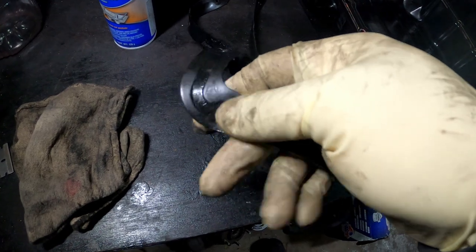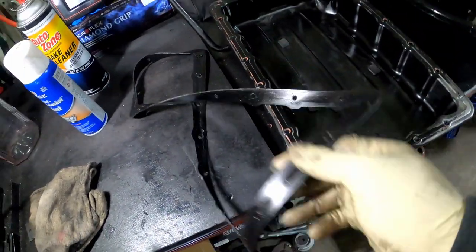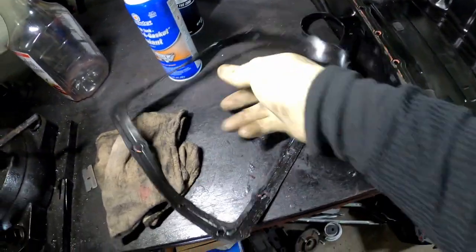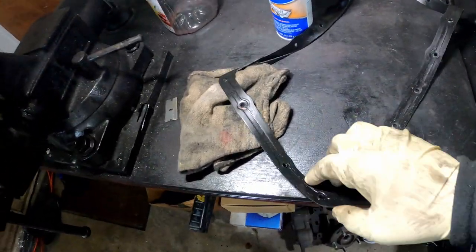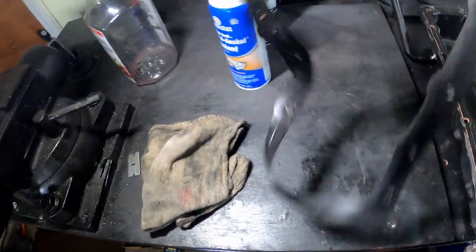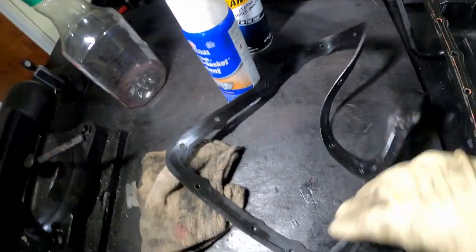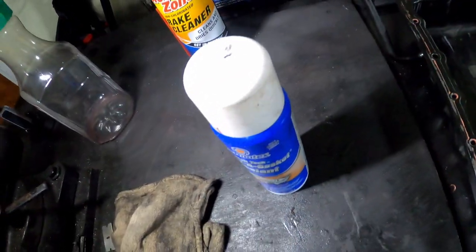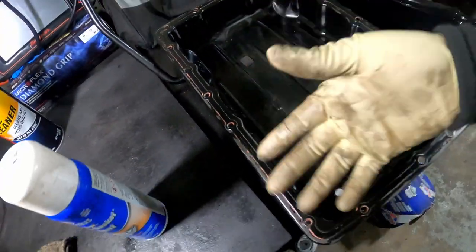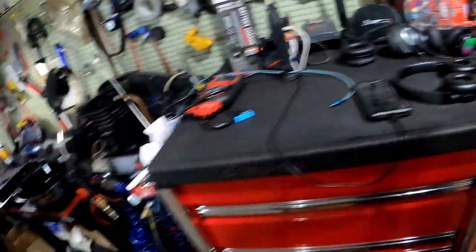From the last time I did it, there's no gasket maker here — look, all the way around. So when I peeled this up off the pan, it came up nice and easy the way it should — it didn't rip. This gasket is still in its shape. It's been used but it's not in that bad shape. Plus it wasn't leaking — I didn't have any leaks. I'm just basically changing my fluid based off my miles. I have no shift issues whatsoever. What we are going to use is some high-tech Permatex high-tech gasket sealant. The only thing to use this for is just to help it seal to the pan so it won't move while you're putting the pan on.